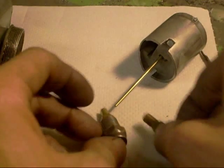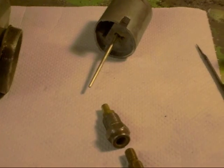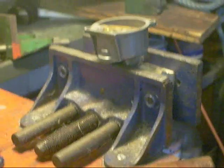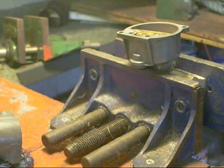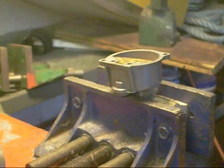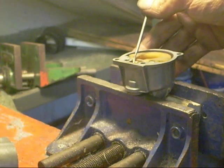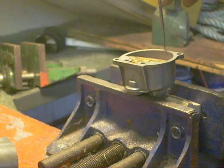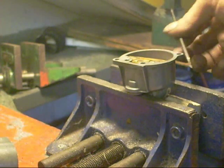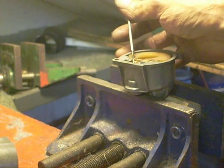That's the standard setup of a Bonneville carburettor. I've done the float level now. There's a little bit of pressure on the back of the float and there should be just a gap at the front — a small gap here — 60 to 80 thou from that surface there. A tad of pressure on the float, and there you go.